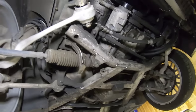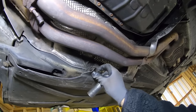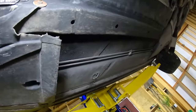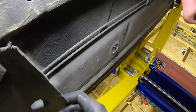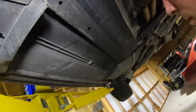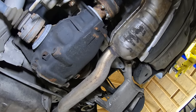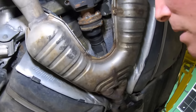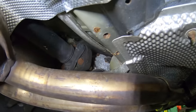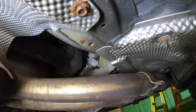All the struts look good. This has M Sport struts on it so it sits a little bit lower, which is kind of an inconvenience. While we're here, a few things need to be fixed — like this needs to be put back on, but now we have a lift so that's easy. This little flap — we're missing a bolt there; we might trim that just a little bit on the very back side to help with clearance on the pipes. A little old residue on the rear diff — I think I changed this fluid early on. The guibo looks really good, and transmission mounts all look good.